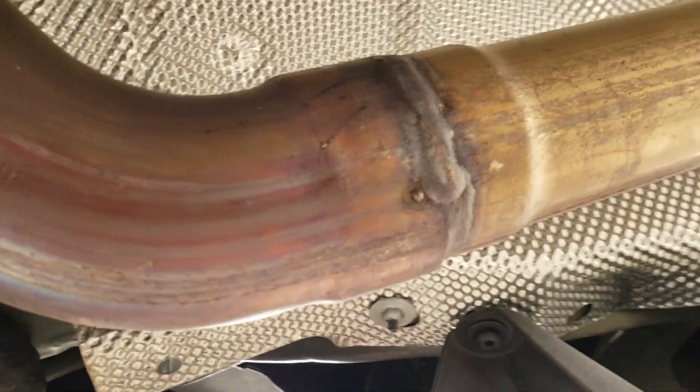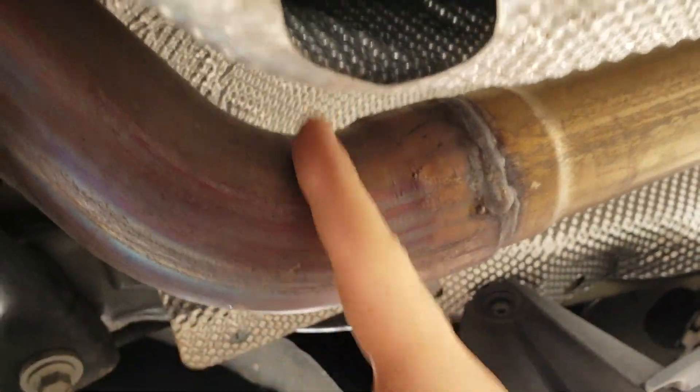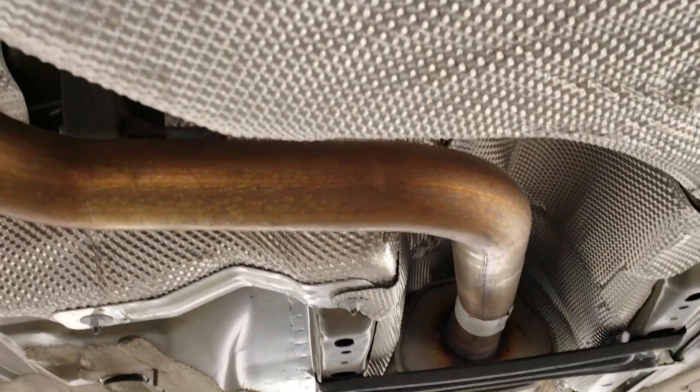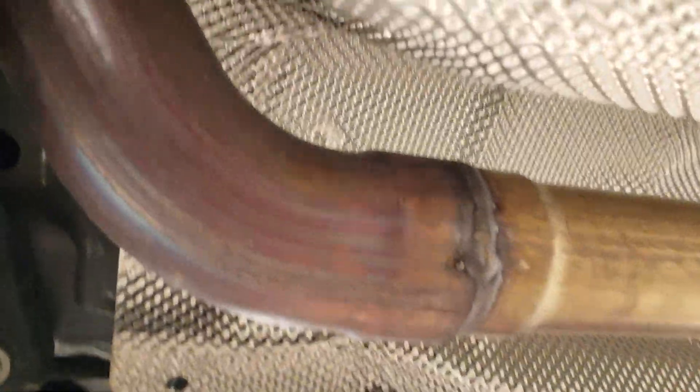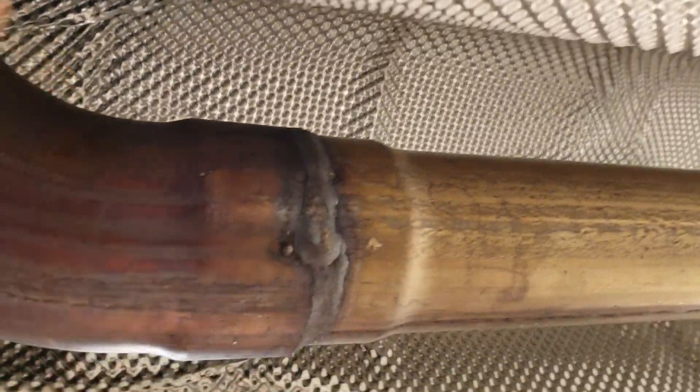Still an American car, but let's get to it. First things first, we're gonna put the car up in the air on four jack stands and go from there. So we're under the car — the factory exhaust is welded here where the muffler is, the axle-back section. We're gonna have to cut this with the sawzall so we can unbolt it at the cat and take it all off as one piece — basically two pieces since it's all one piece from the cat to the muffler tips.